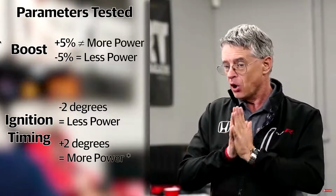Are we going to go onto the street with this? Not for this particular vehicle, no. Hondata has built some safety margin into their calibration. So if for whatever reason the fuel filled up at the filling station is very low quality, you've got a little bit of margin for error there. But if you're the kind of owner who runs only the best, highest octane fuel, then you can have this calibration tuned for more horsepower should you wish.